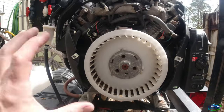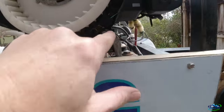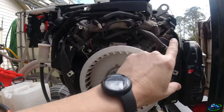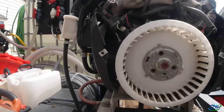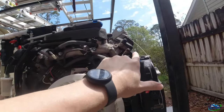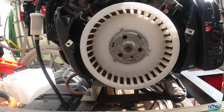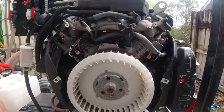Guys and girls, we've got a total of six fasteners — four bolts and two screws — to get this out. One, two down here at the bottom, three, four, and then you've got two screws here. This cover pops off and exposes the coils. He marked it and put the aftermarket resistors in there. So we're going to go ahead and disassemble the coils. We may have to take this nut out to move it and get the boot through. We'll figure that out and go ahead and change that out. We've got both coils, so we're going to see how it runs after that.